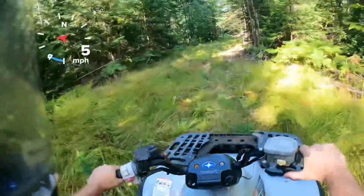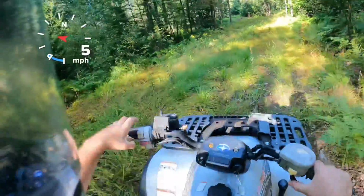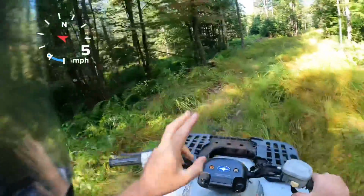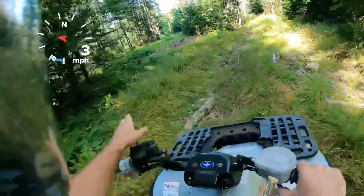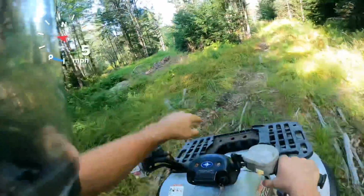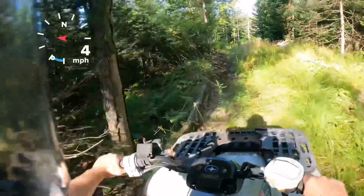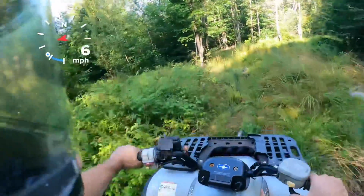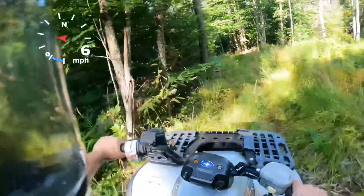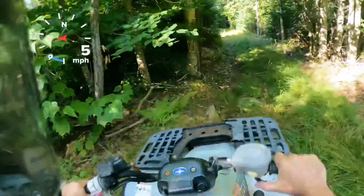Now this has a solid rear axle in the back, so you don't have to worry about any CV boots or anything like that back there. Up front you do have two CV boots. You have one on the outer of the left and the right. The inner CV is actually a U-joint, so it's a little bit different. Polaris used that setup on a few of their earlier model Sportsmans and Magnums, and probably some other models too. Actually, my diesel's like that.